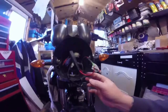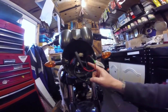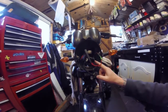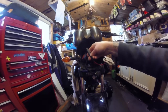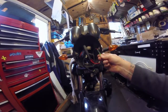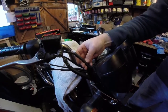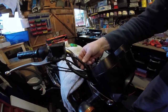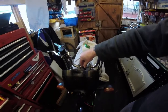Let me show what I'm talking about. I had to completely rewire this and I've put a sleeve under here. So if you're ever going to get a Chinese ignition, a cheap job, be careful because the wires were all wrong. So marry up to what you had before. Here's the sleeving and underneath there I've connected all the wires. And here's one where they tried to cut it. I'm going to see whether this heat shrink works rather than using green or black tape — I thought I'd use the heat shrink. It looks a lot smarter and more professional, and the ignition is in.